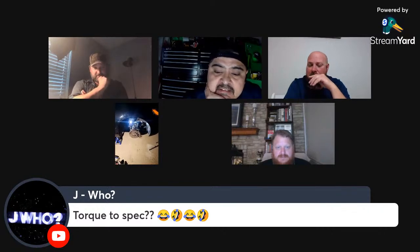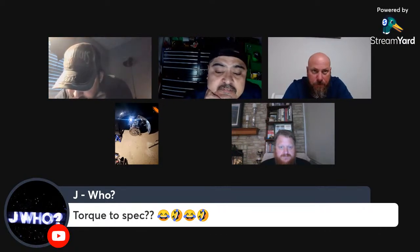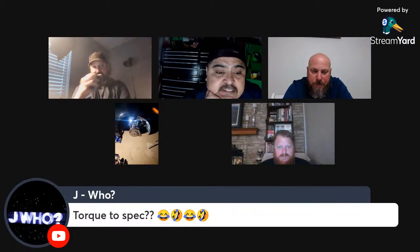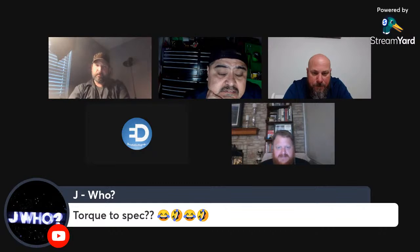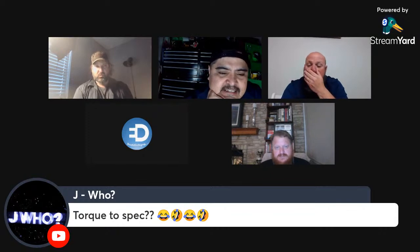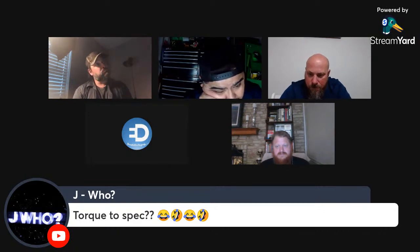I have a question that Cass probably can answer for me. I haven't come across a whole crap ton of vehicles where the motor mount bolts are torqued to yield. I did recently. Have you seen that, Cass? Well, I mean, kind of. Torque to yield is as far as like angle torque on them? Yeah, I believe it was a '17 Explorer, and you torqued it, I don't remember the whole thing. You backed it off, and then you ended up doing a 90 on it. I've seen that plenty, but not on a motor mount, not an engine mount.